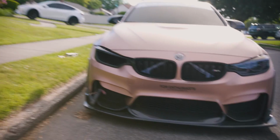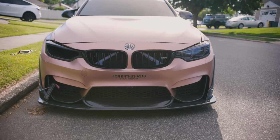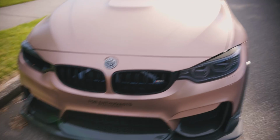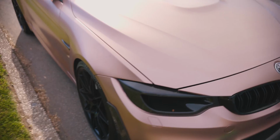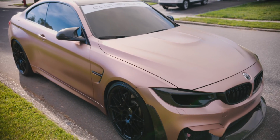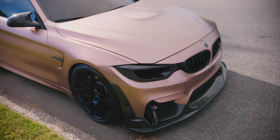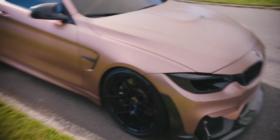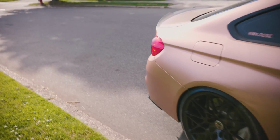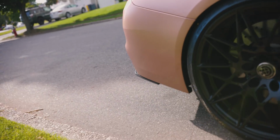It kind of blends in. You can't really notice it during the day, but at night you can clearly notice that one headlight is out. I do have a warning on the dash, adaptive headlight malfunction, to be expected. And if I do a right turn signal, the back still works, but it just hyper flashes. So I don't know if I need to do a relay setup or just leave it as is. That's pretty common, because if you're missing the front and then the back gets too much voltage or whatever, it starts to hyper flash.